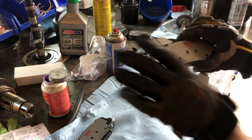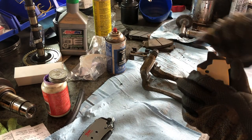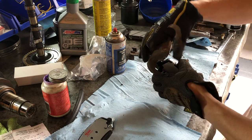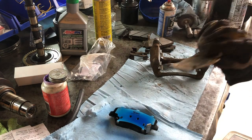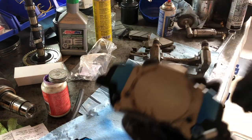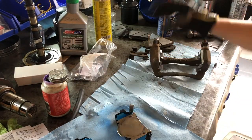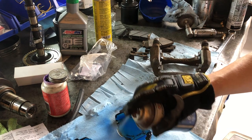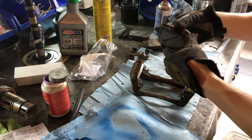We want to see how well our pads fit before spraying them. Sometimes if they're really tight it means the bracket may not be cleaned well enough, or sometimes the manufacturing of the pads means you may have to shave a tiny bit off to make them fit. I always like to pre-fit everything first — these ones fit great. So now to prevent brake squeal we're going to spray them. The factory shim is a really good shim — we're going to reinstall it and give it a little spray on the back as well, lining up the tabs. Then we load our pads back into the caliper bracket.